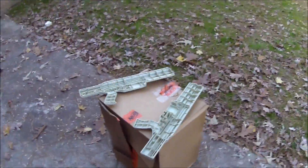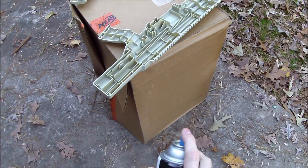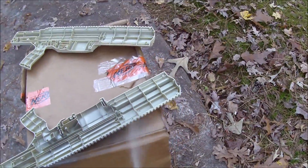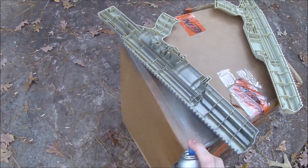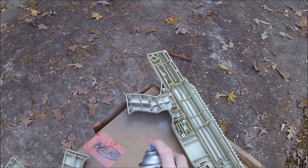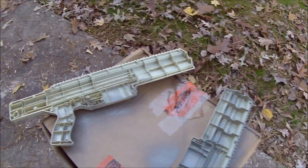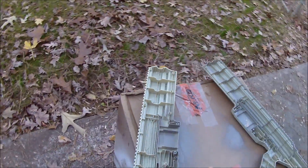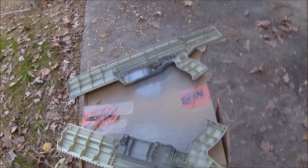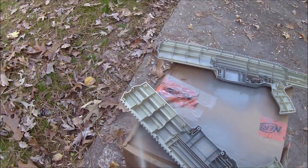Before we put on our green enamel, we have to have a solid base coat for the X-Zeus. I'm doing that with a gray vinyl dye. It'll allow our green to still be very neon and vibrant as opposed to using black for the base coat. This is really just to ensure proper adhesion. We're putting it on this side to make sure we absolutely get these rails so that no tan shows through. A lot of people skip this step where they don't touch up inside areas, and I think that is a mistake. I like to make sure that open ports don't show through, so the magazine well is now gray instead of desert tan, as well as the port for the release from the inside and out. You will be able to see inside the blaster, but the inherent darkness inside the shell will protect you from seeing that tan.